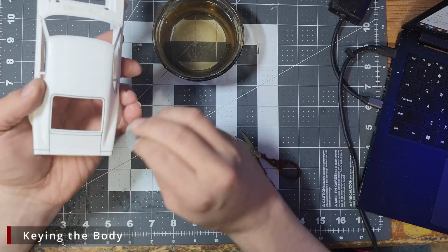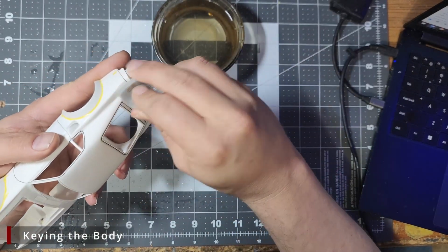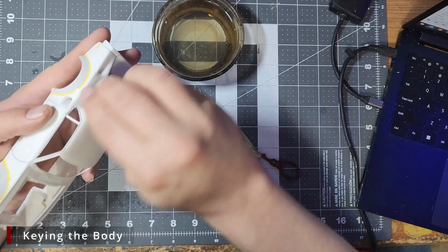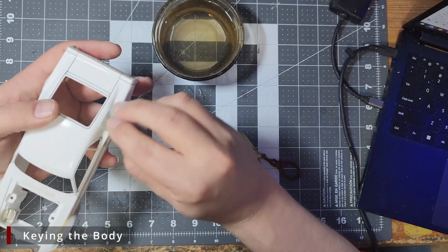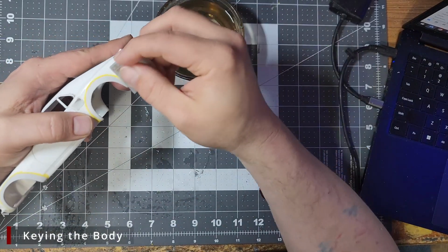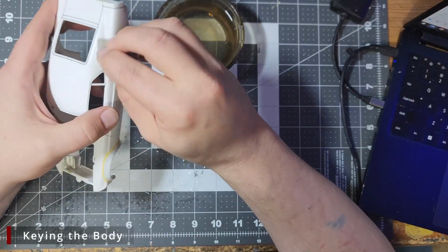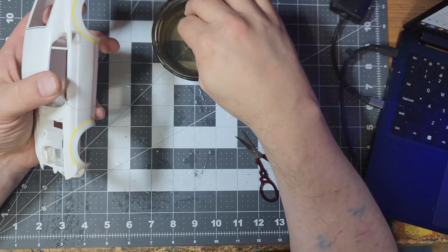Now between every grit of sandpaper, I throw out the water and I get fresh water to wet sand with. If you keep the same old water, you're going to get the sanding material from the lower grit sanders onto your current sandpaper, and you're going to end up putting deeper scratches into the plastic rather than removing them. Once done, we will follow up with Tamiya's 2000 grit sanding sponge as well, and that should really get us ready for primer and paint in the next video.